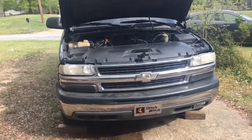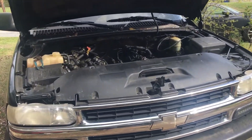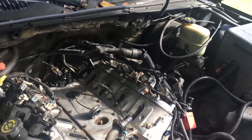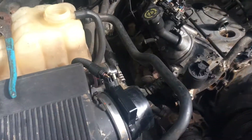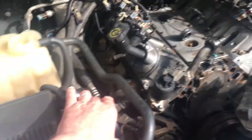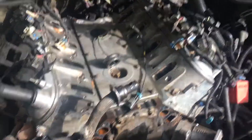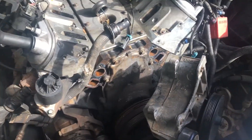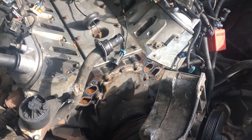I'm not going to go into all the details of how to disconnect everything because there are all kinds of videos on YouTube for that. I'll just talk about the highlights of what I've done so far. As you can see, the intake's gone and I'm kind of down to a long block. The first thing I did was move the ducting from the MAF sensor up to the throttle body — took the clamps off and removed it. Then I took out the top of the radiator shroud.